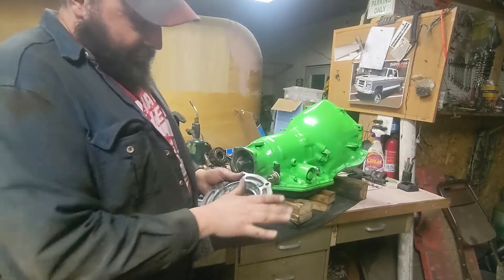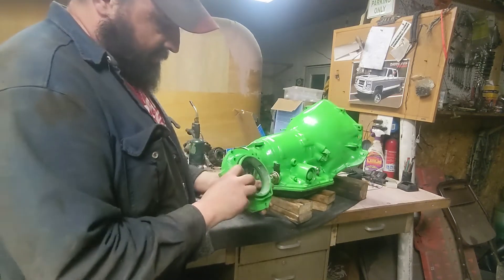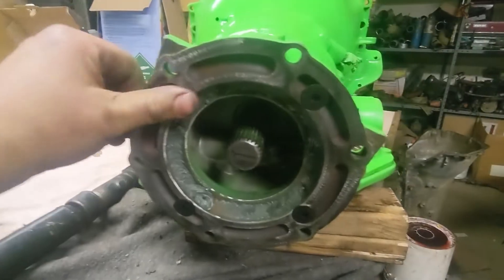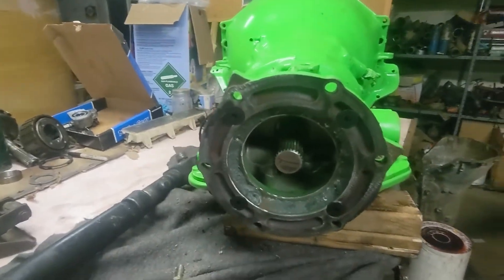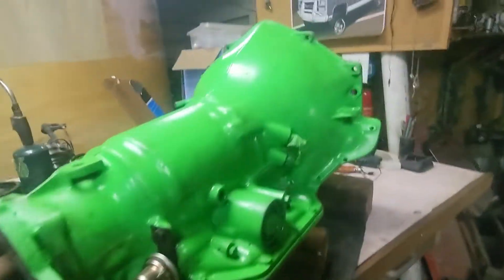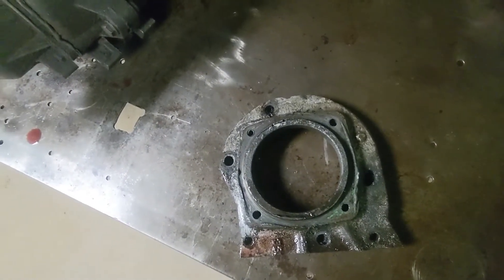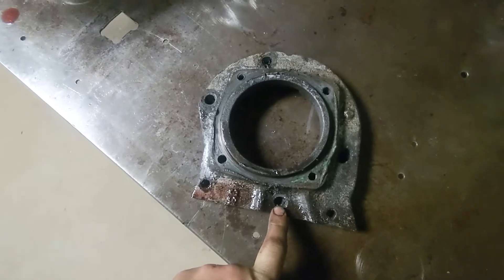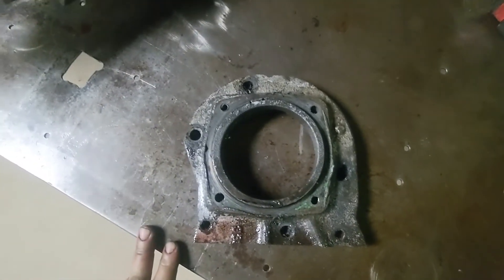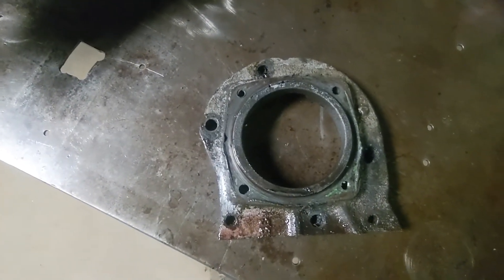Now we've got our adapter modified. I went ahead and ground everything down, cleaned it up, put some paint on it. Now we're going to go ahead and get this installed on the transmission — put a new seal on here. You can see all my bolts countersunk nicely, everything is below the surface. I'll put a little bit of sealer on there with a new gasket, and that will seal up really nice. I'm excited to have no more transmission leaks. This is the adapter I'm replacing — a modified NP208 or 203 — with this one I can only get four bolts into the transfer case, which I really think is a big part of why I wasn't sealing well.